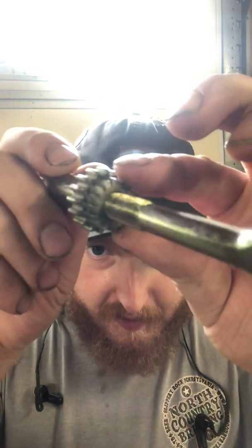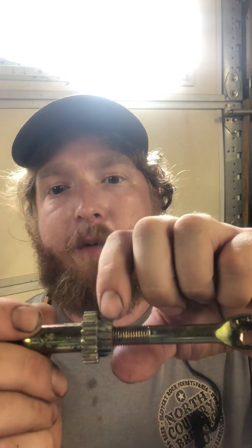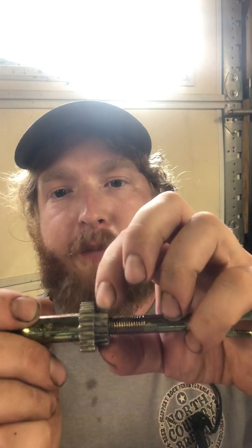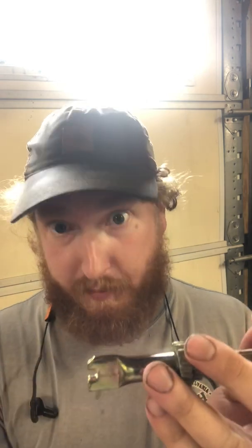If we look closely at this gear, it has a set of ratchet teeth — see that, they're at a little angle — and a set of straight teeth. Those ratchet teeth catch on the cog wheel so that when this ratchet's open it gets bigger, clicks in, but it can't go the other way. These straight teeth are for the manual adjustment of the brakes, which you can do through the backing plate on the back.